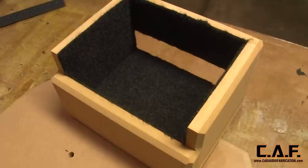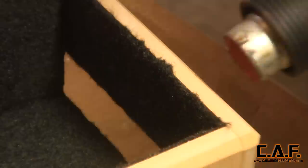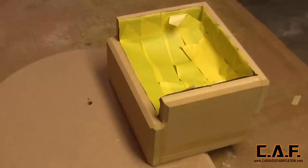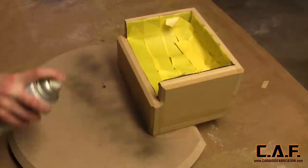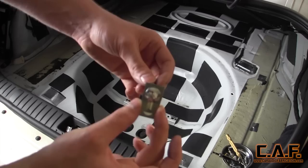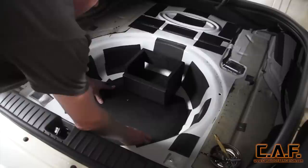After trimming the carpet it looks pretty good, but we still have some fuzzies along the side. Here's a cool trick: if we take a heat gun and quickly run it along this edge, it will actually shrink those fuzzies. This is a good little trick to use on subwoofer box carpet seams as well. With the carpet now masked off, I'm going to start spraying some paint. I'm using a high-build flat black paint, which works well on MDF to seal up the surfaces and gives a pretty good finish — though you could also consider using bed liner paint. While the paint was drying, I went to the hardware store and picked out a bolt that matches the OEM bolt, fitted a small metal bracket to it to keep it from rotating, and put it into the OEM slot.